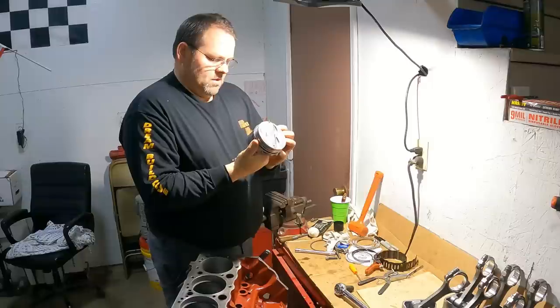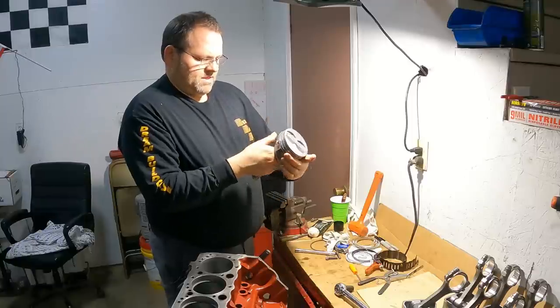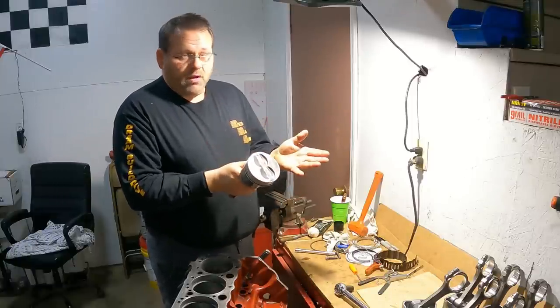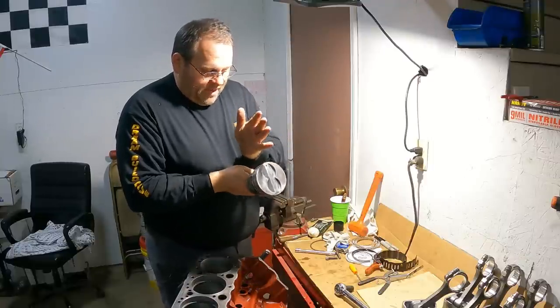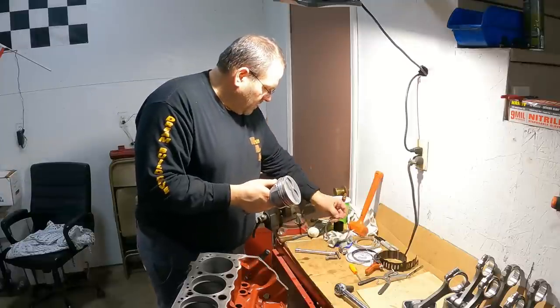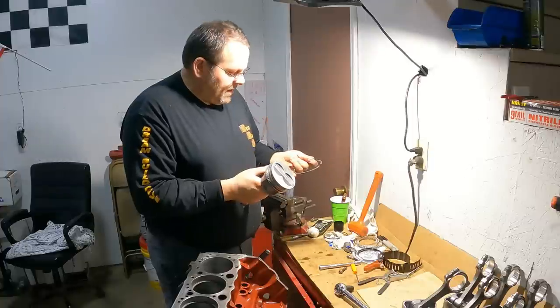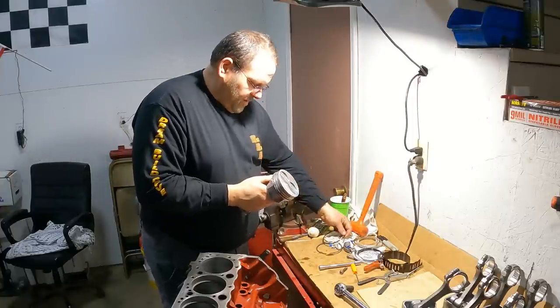These are just steel, but they're pretty tough, they won't mess up. Okay, so like that expander, I've got, and they're all gonna move around, y'all. This is just your starting point. But so if the expander was at 12, I do like 10 and 2 on it. And then I'll turn around. And of course, I've already identified and got in my head, I know how to quickly identify that's a top ring. That's a second ring.